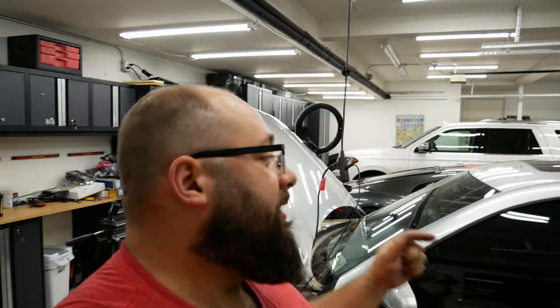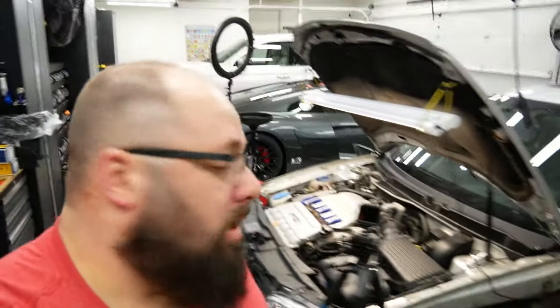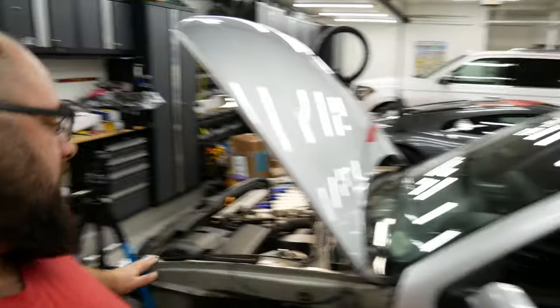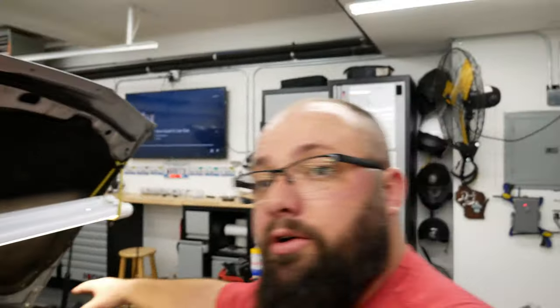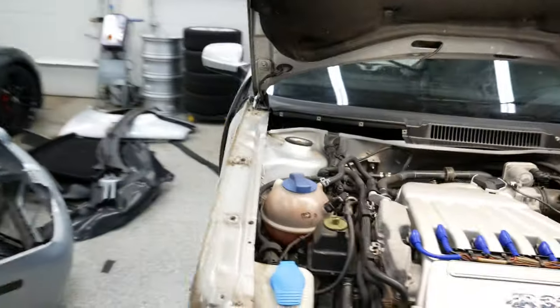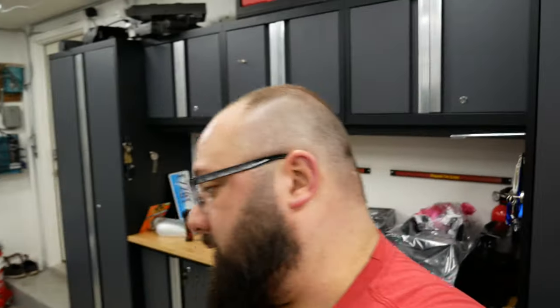By the way, if you haven't seen all the other videos about me rebuilding this R32, be sure to subscribe and hit the notification bell so you get alerts for new videos. There's a link above for all the old videos — there are about 20 of them. When sliding in the rain tray, slide it in from the front. If you do it from the back you risk breaking the tongue and groove. I found it easier to hook it on one side and work it towards the back, and it actually created a good seal — no gap. Pretty easy install.